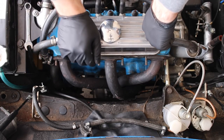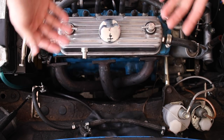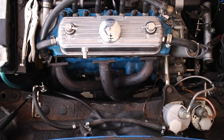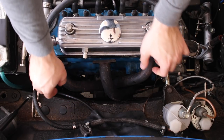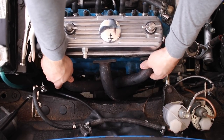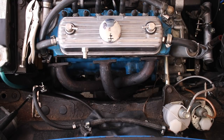Now I just repeat the process with all the other studs. With the studs loose, I'm hoping to lift the manifold out and pull it up and out of the way. This free-flow manifold is kind of unwieldy — it's part of the reason I'm switching to the Maniflow option. Since it's all one piece, it's much more difficult to remove. I'm wiggling it around with not much luck, so I think I'm going to have to loosen my engine mount to pull the motor forward and work it out.